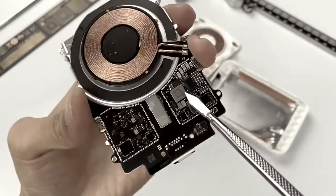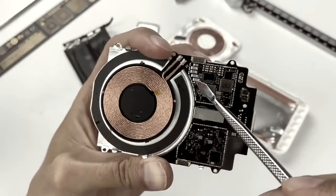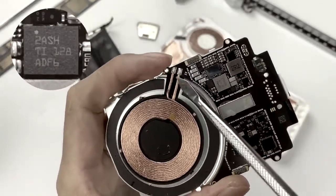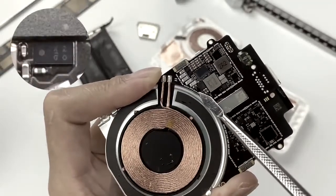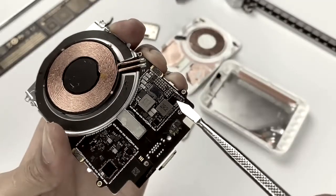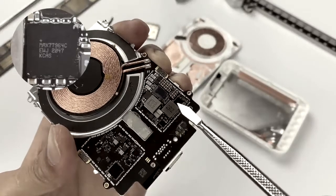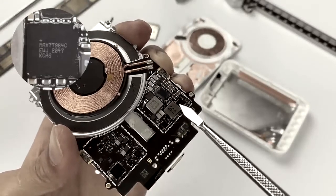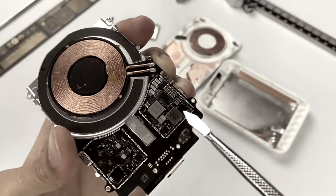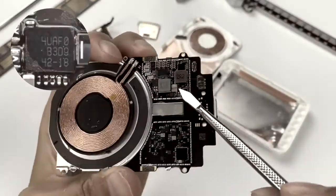Now let's look at the right circuit. You can see two inductors, so it has two voltage conversion circuits. The first is the power supply circuit of wireless charging — a synchronous boost converter from Texas Instruments that powers wireless charging with the boost inductor next to it, and a Schottky diode to improve conversion efficiency. The second circuit is the buck-boost circuit. The big black chip is the buck-boost controller from Maxim, the MAX77964, which supports input of 23V and output current of 3.2A, suitable for charging two lithium batteries. It also supports reverse buck output to power external devices. The inductor next to it is used for voltage conversion of battery charging and discharging. There are two additional chips here but we can't get specific information about them — if you know, please leave a comment below.